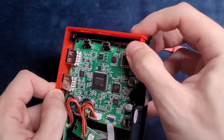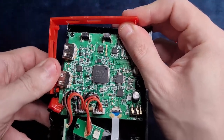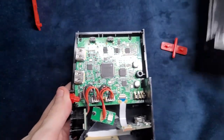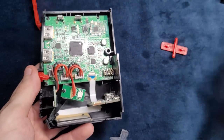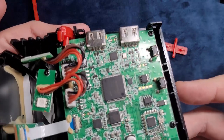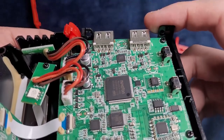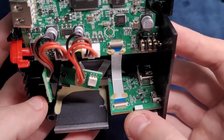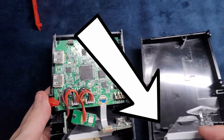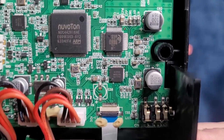Here's how the front piece is connected. All of the soldering points on the board are well made, and the USB ports can be desoldered and replaced — they are the first point of failure due to constant connections. This small board here seems flimsy, but the other part of the shell has a plastic support which holds it in place. The flat cables are glued in place and the connectors won't release that easily.